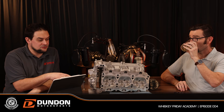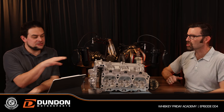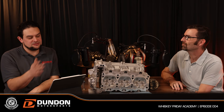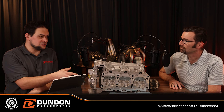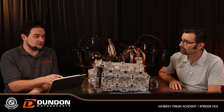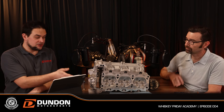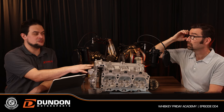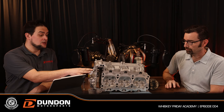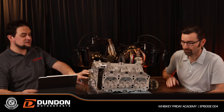There are a lot of assumptions out there: this engine has this, that engine has that, why do these engines have these problems? For example, why doesn't a 911 GT3 of any variant have variable valve lift — why only the big fixed lobe? This 981 GT4 head, which is essentially the same as a 997.2 / 991.1 Carrera, only has variable intake cam timing.